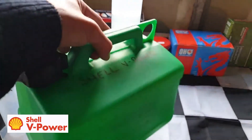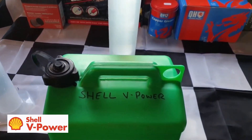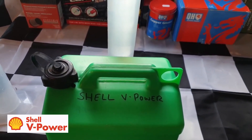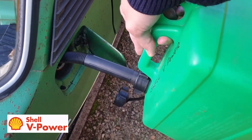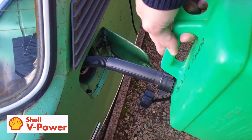For now I'm convinced this latest batch of V-Power is still completely free of ethanol, and I'm going to pour the rest of this into my 1977 Cavalier, which is currently on fumes and has just had a brand new carburettor fitted. Its running issues may well have been caused by it being run on E5 in the past, and now I'm not using it every day I don't want to have ethanol sat in the float chamber.